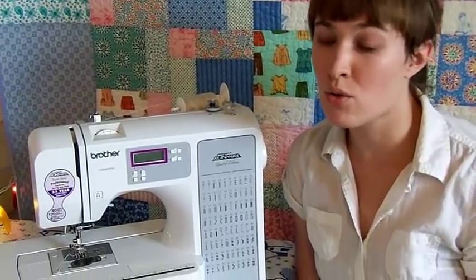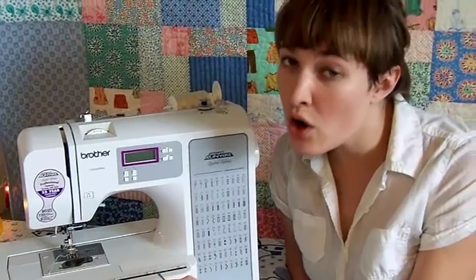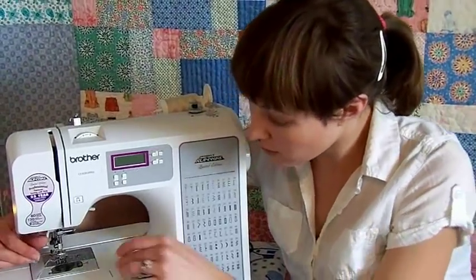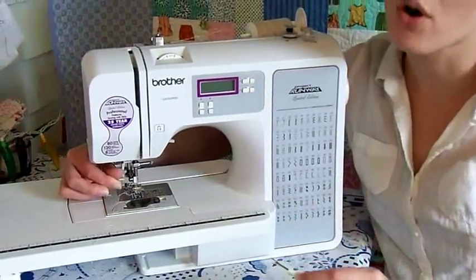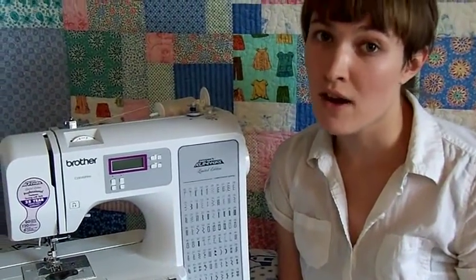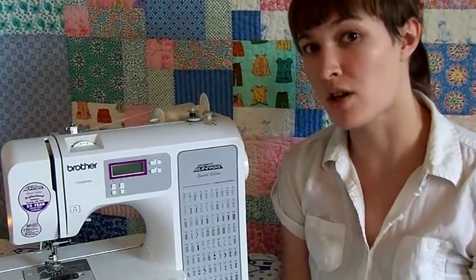I have found that the best tool is a seam ripper. You can just gently nudge the hook back into place. You could also use a small screwdriver. Lower the lever and just gently push the hook so it passes through the eye of the needle once again. This is a nice and effective quick fix. Just make sure you know which way the hook is bent so you can make the correct adjustment.